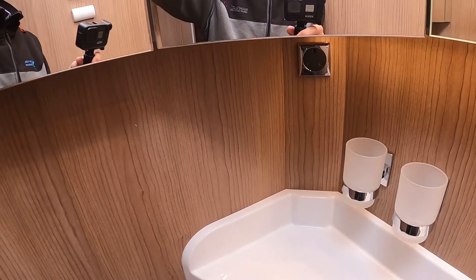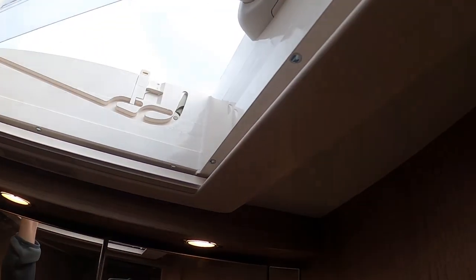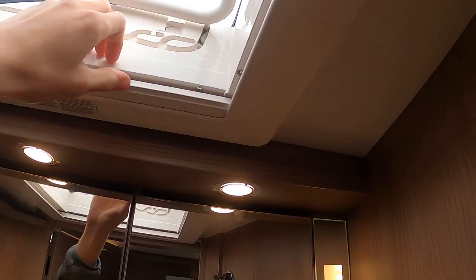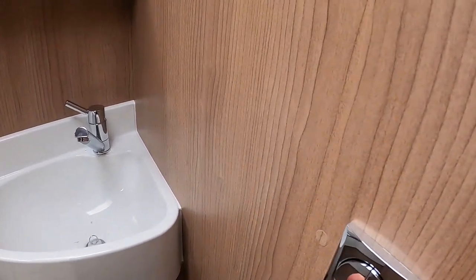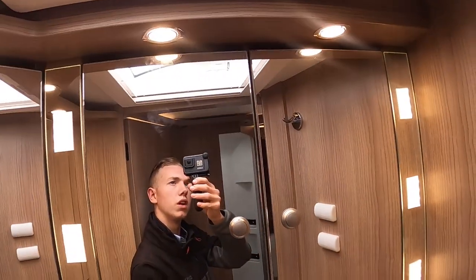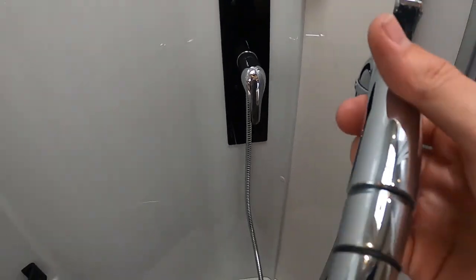You've got storage for your toilet necessities. To open the skylight, push the clutch in and slide it along into the groove for ventilation on a nice day. Always make sure all windows and skylights are closed when in transit. You've got a blackout blind and a fly screen, and your lights are here — one for cabinet lights and one for main lights. For the shower, the shower head is removable and it's a handheld shower with a trigger gun. When winterising, allow the hose to lie in the shower tray to stop water building up in the U-bend and freezing.